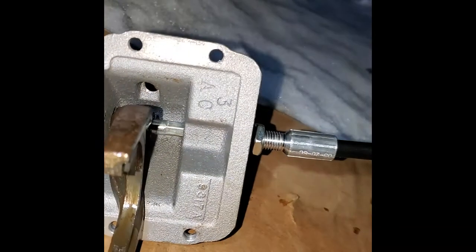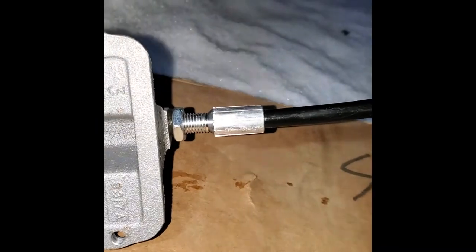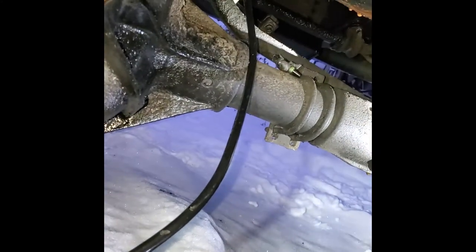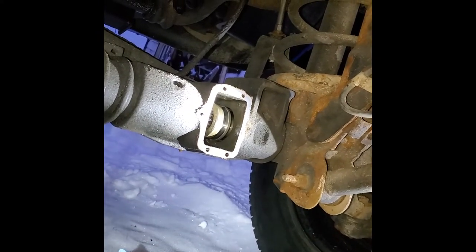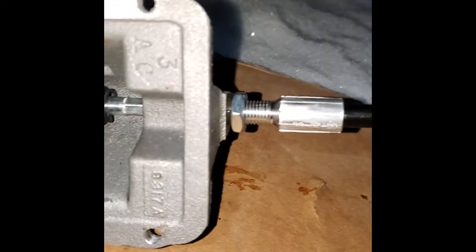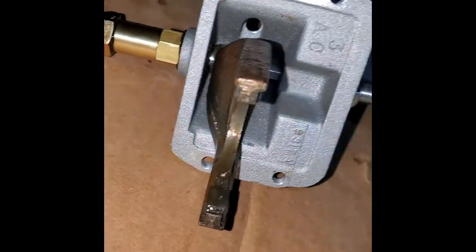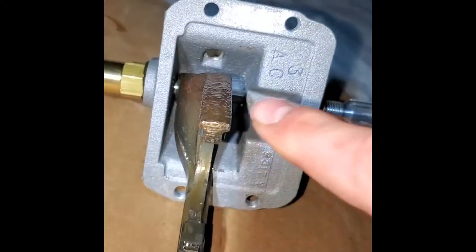The only question I have is how the cable is going to like being twisted around to mount to the axle tube. So what I might do is leave the lock nut loose until I get the cover loosely fastened in place, just in case it needs to rotate - because this cable does not flex really at all, it's quite stiff. I'm going to go ahead and put the CAD housing on the tube and get the bolts in there loosely, then tighten up the lock nut and the CAD housing cap screws. The only thing left after that is to put the axle vent tube back on.